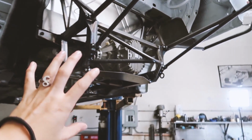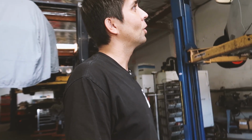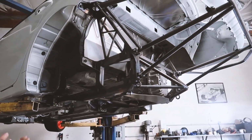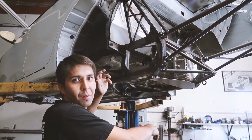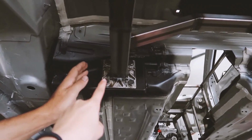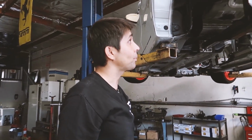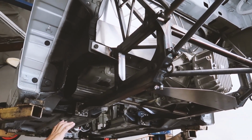Write it down, everyone. This glorious masterpiece in the back here. So this is probably the craziest thing I've seen, and this is the first time you guys took a crack at completely re-engineering the back, right? Yeah, because usually when we build cars, we just use what's there and modify it to make it better. But this car was a front engine, front wheel drive car that we were asked to convert to this platform. So basically we cut everything in the back off. I had to weld some tie-in points to the chassis. So you have three main contact points on here, one right side, yeah, this, that, and the shock tower, which will all get tied into the roll cage later. So that was the first step, and then the second step was to basically create this frame.